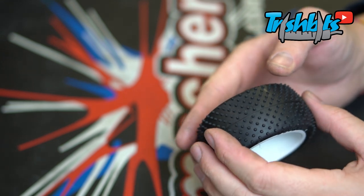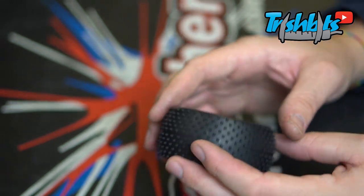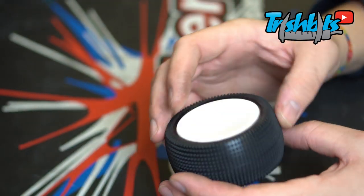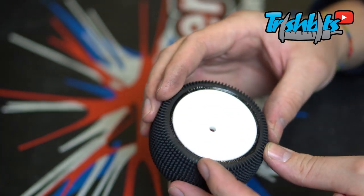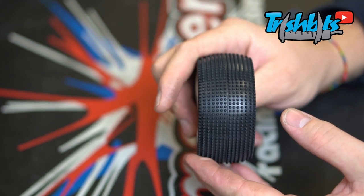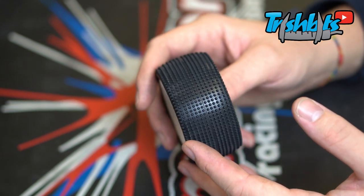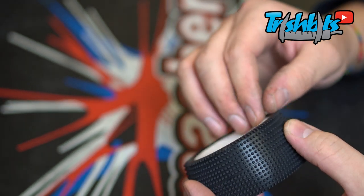One last thing to talk about is trimming the tire. If you get the tire and trim off the outside and inside rows — especially for astro racing in the dry — it will take away a little bit of grip and make the car easier to drive. If you're getting grip-roll issues, just drop the outside and inside row off. On the cactus tire, there are ribs that sit on the outside — kind of like a small stagger — so when you go into a corner the car can slide a little but gives more forward traction.